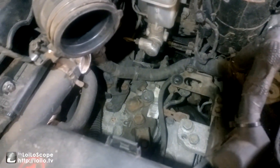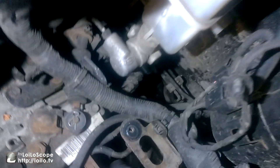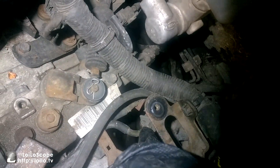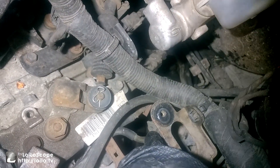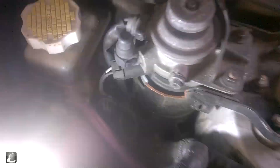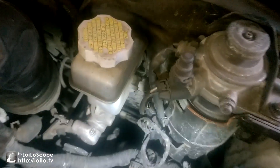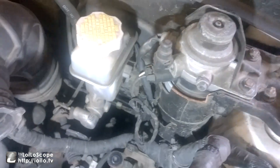I have the airbox disconnected now. The reason why you take the airbox out is to allow more room to gain access to the fuel pipes at the bottom. There is a fuel line down there that needs to be disconnected as well, and there is another one which is harder to see, but it's right in there at the back. So there are two fuel lines that need to be disconnected. I'll loosen these off and sling that over, which will allow more access to disconnect the clips.